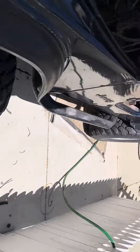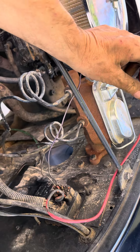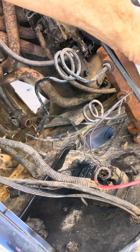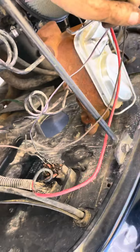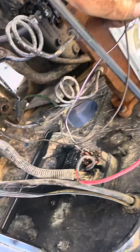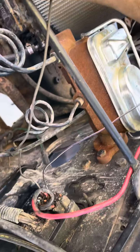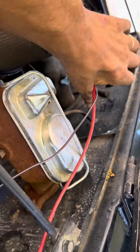It simplified the wiring across the bulkhead — it's now down to three wires, maybe only two. It needs a battery feed for the Jeep, the temperature sensor which is part of the gauge in the speedometer cluster, and this wire that was cut — the generator light wire. Down from a bundle of about ten wires to just two that are really needed to run this thing.